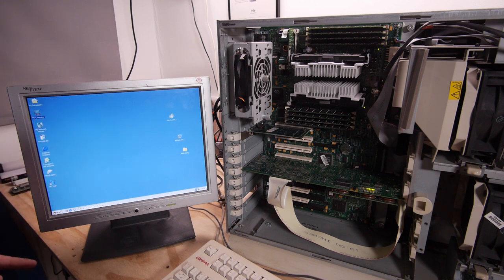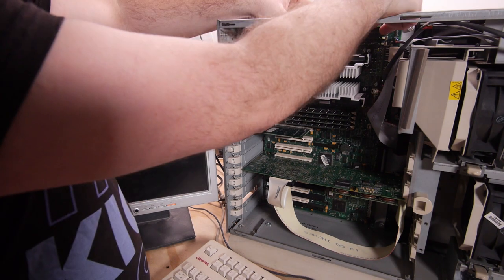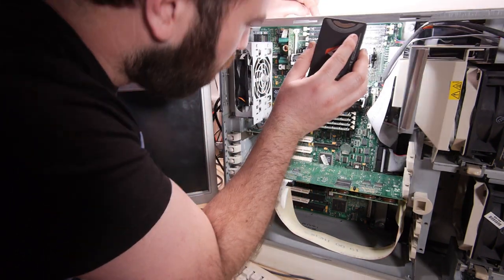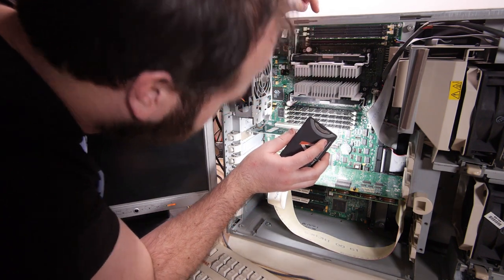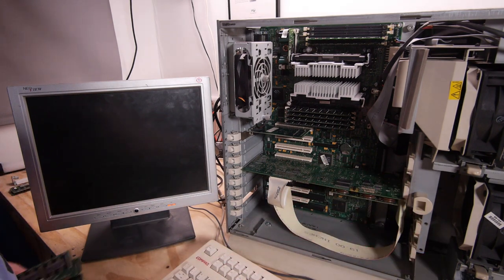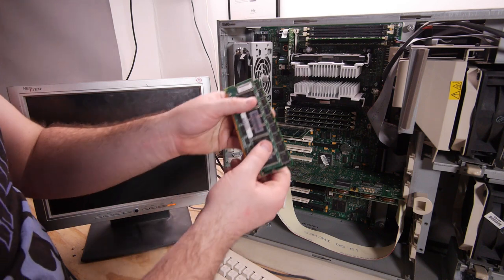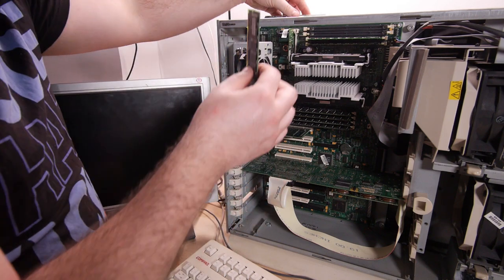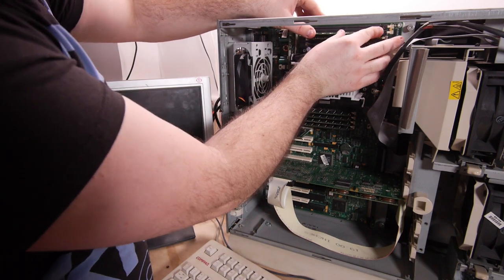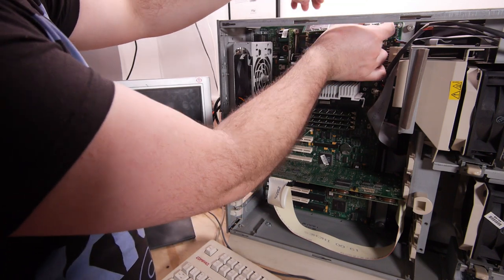Also take the Quantum 3D sticks out, and I will put in less memory. So we're gonna take out the two top sticks, the APACERs. Let's see, we have Samsung memory here, Samsung, Samsung, Samsung, and Samsung. Because the 256 megabyte sticks, we have two Hynix and two also Samsungs. So let's put completely Samsung memory in it. Instead of 4GB, we will go for 3.5GB with the 256 sticks on the top.